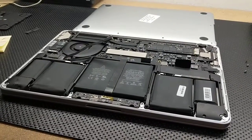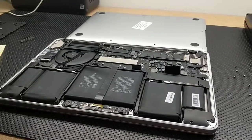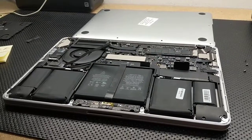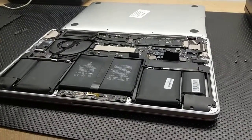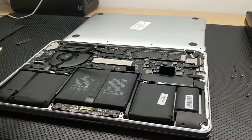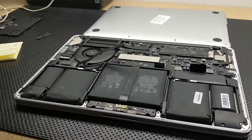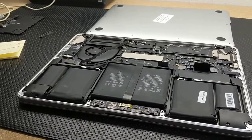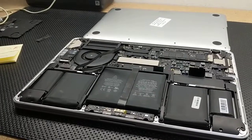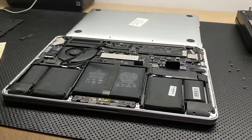So if you've got this problem — a 1502 early 2015, motherboard 820-4924-A — and your power button works but your keyboard doesn't, and you've already tested a new keyboard and can't figure out what's going on, the trackpad or trackpad flex could be causing that. And the specific symptom we had: the power button would not turn on the unit but would turn it off. It wound up being the trackpad. Hope that helps anyone out there — thanks for watching.